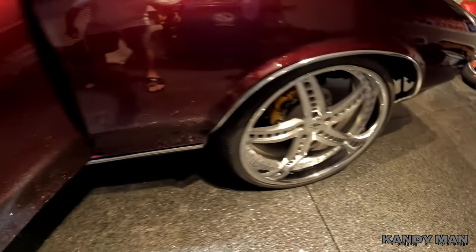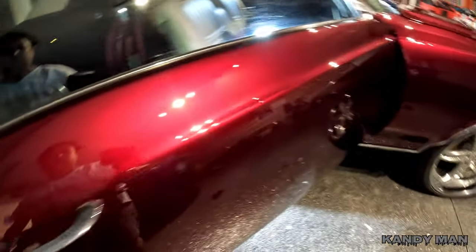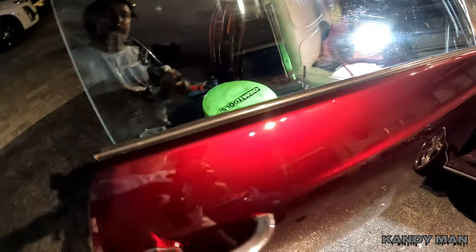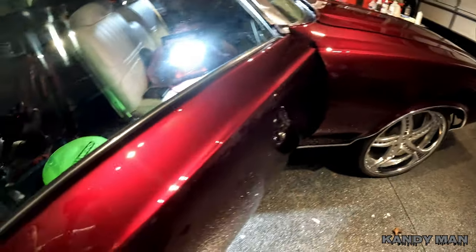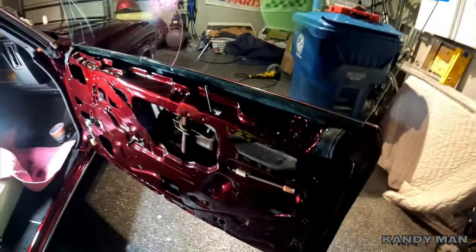Wheel well trims, wheels, and we're gonna keep putting it together, but just wanted to show you the felts are in on the door. Those gotta go in before the windows. Make sure you put those in before the glass. Don't put the glass in and then forget, because you can't get to the screws. So we're just putting her together, and just wanted to show you a little bit more of that as we're doing it, little by little, but it's coming along nice.